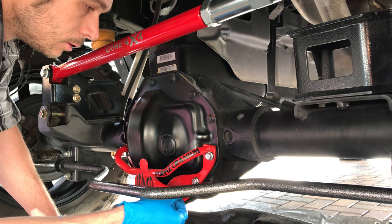Ew. All right, just really quick so you see what I got going on here, how I'm cleaning this RTV gasket crap off. I'm using a razor blade to get the big chunks off, which is seemingly pretty easy. All this stuff just came right off with ease. I'm gonna do this on this mating surface, and then also on the mating surface on the other side, the axle. Then after I get as much of the chunks off as I can, 1500 grit wet dry sandpaper. Yes, I'm going to get all the orange off of this junk.